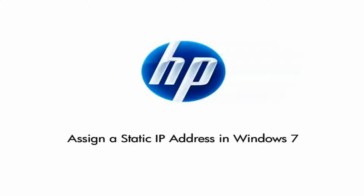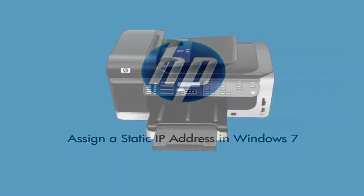If your computer regularly loses communication with your wireless HP printer, it can help to give the HP printer a static IP address. This address will not change over time, and your computer might have an easier time recognizing the printer after long periods of printer inactivity. This video shows you how to assign a static IP address on an HP printer running on Windows 7 using an internet browser. Some printers will have slightly different steps.